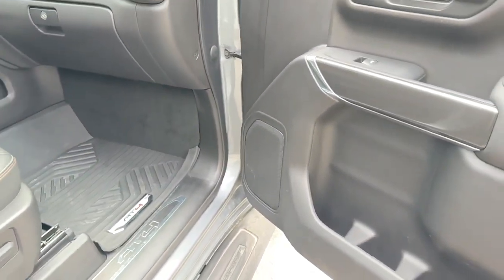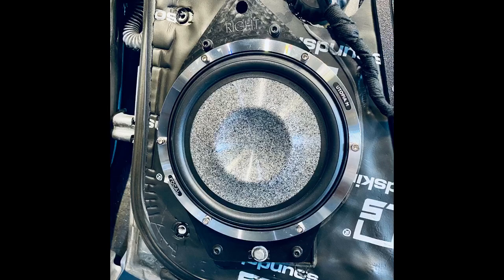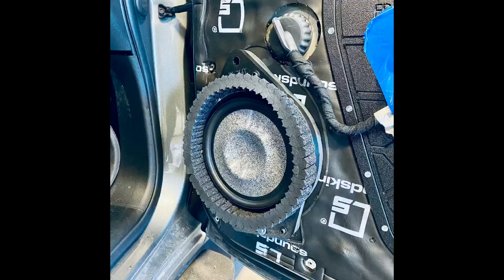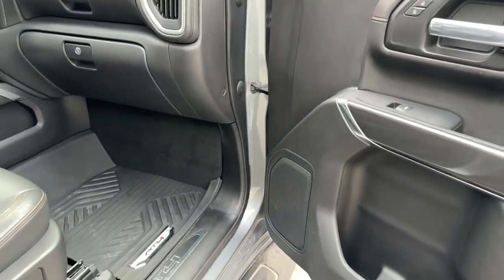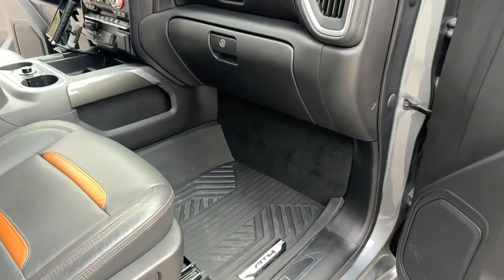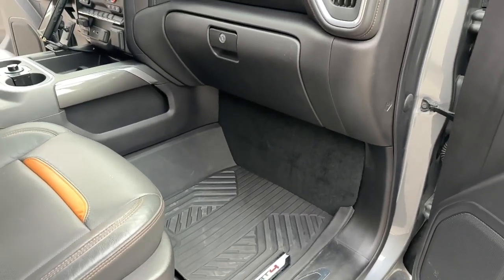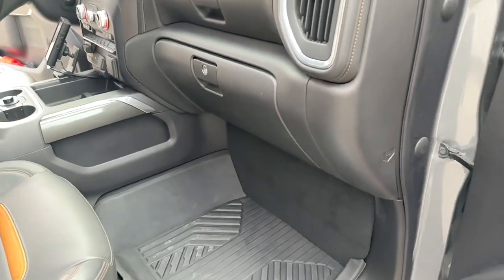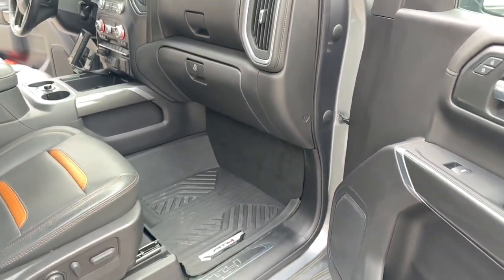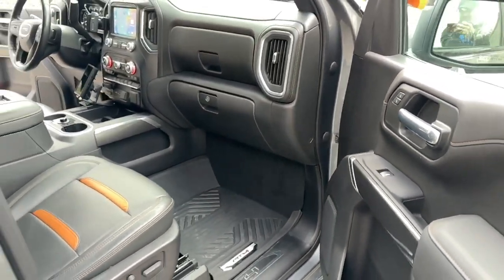The doors are a Focal Utopia 8WM. They beat the crap out of my doors, but they pretty much hold together. Again, those are crossed from 250 or 240 down to about 100. Front sub runs 55, I think, yeah, roughly 55 to 100 right now, and then rear subs take over from there. So let me walk back over to the driver's seat, and I'll give you guys a tour of the nicest part of the front stage, in my opinion.